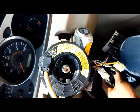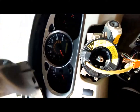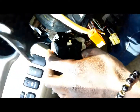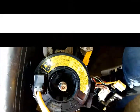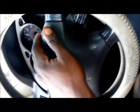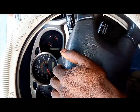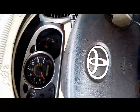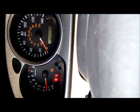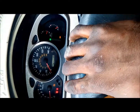So now what I'm going to do is turn this back to where it belongs and fix these two connectors — and the rest is just the reverse. So guys, just for the final show: I've changed my airbag ribbon, it's set in place. You can hear that my horn is working fine now. Let me start my car and show you that my airbag light is out. This blinking one is because I'm not putting on my seat belt. I'll rectify the check engine light later on. So you can see the airbag light is gone and my horn is blowing fine.